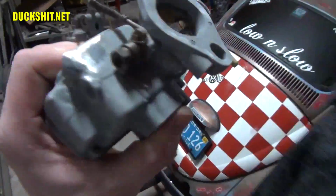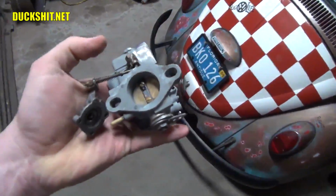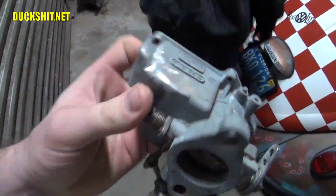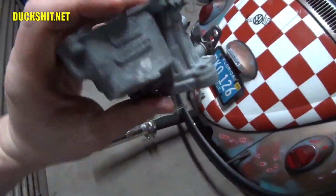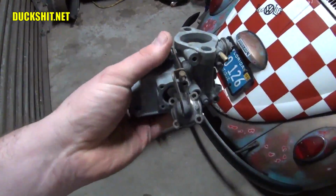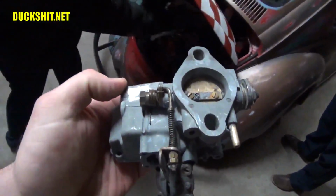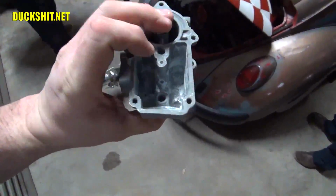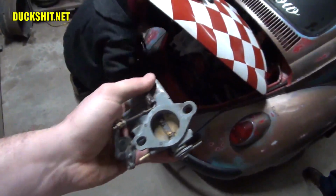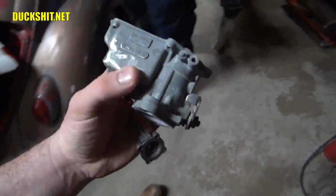And I didn't show this on video, but this is Don's Dellorto carburetor. He and I were having a conversation about these things, and he had a hole in the bottom of it. It looked like somebody drilled it with an 1/8" drill bit, and he wanted it filled. So I used some aluminum weld. Started to weld it, and I wish I got that on video because the propane torch actually blew a hole in it. I don't know what kind of alloy this is made from. Aluminum melts at 1200 degrees, aluminum weld melts at 700 degrees, and that sucker burned a hole right through it about the size of a dime. So I had to very carefully melt only the aluminum weld and blob it on, and then finally grind it down. I made a little plug for it. So anyway, I put that on his workbench for him. He's going to owe me one for that.